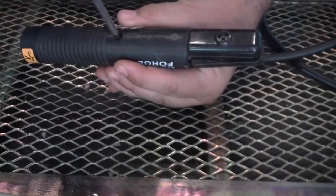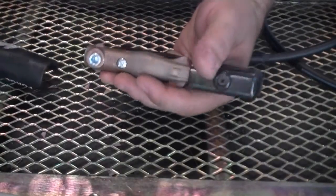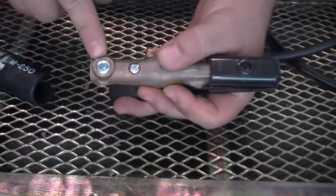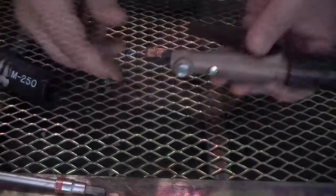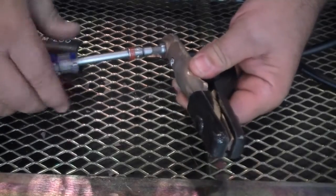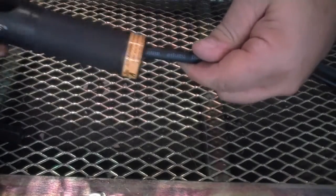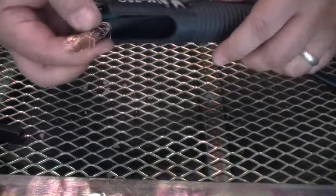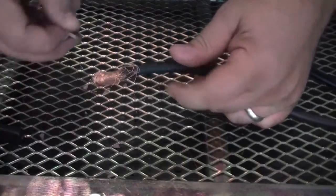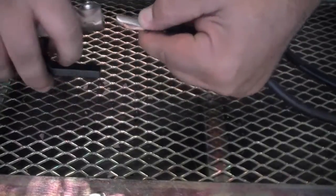The installation of the new tong style clamp is just as simple. With this type of cover, the screw goes through the other side of the cover and jams it tight — loosen this screw but do not attempt to remove it. Typically you'll find one or two locking screws on the metal body which hold the cable tight. Loosen the lock screw completely so that you have no trouble sliding the new cable in. Be sure to slide the handle on first before you try to insert the cable. When you insert the new cable, make sure that you insert the shim with the cable.